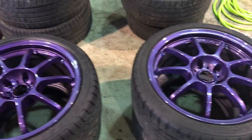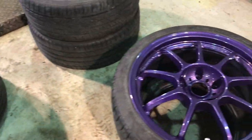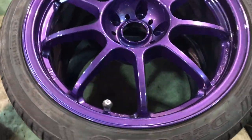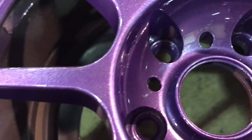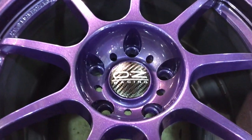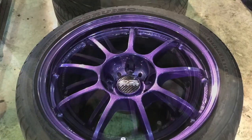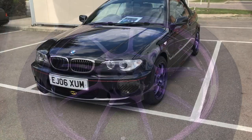As you can see here, this is it actually lacquered — I went over it with the full coat and then got the spray gun out and did the lacquering. If you want to see lacquering techniques I will show you in a separate video. As soon as you can, pull the tape off — if you leave it on and peel it off once fully dry there's a chance it will peel the paint off too. These center caps were ruined so I sanded them down with 2000 grit sandpaper and went over them with lacquer at the same time as lacquering the wheels.